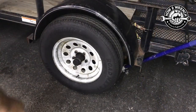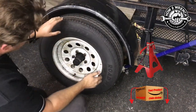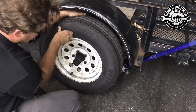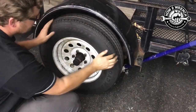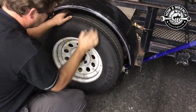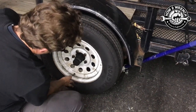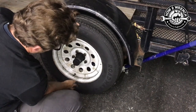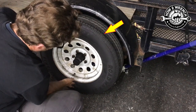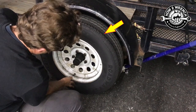Alright, we got the trailer flipped around, jacked and re-supported with a support jack — see if you can hear it now. It's pretty loose — a clunkity clunk. Let me clip this in slow motion. If you watch the edge of that tire, you can actually see it wobble back and forth. It's really hard to show at normal speed, but look how loose that wheel bearing was.